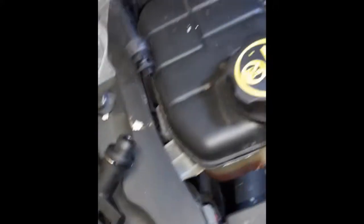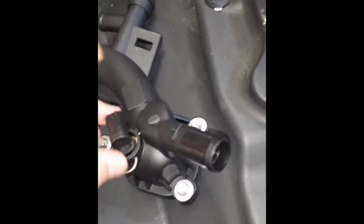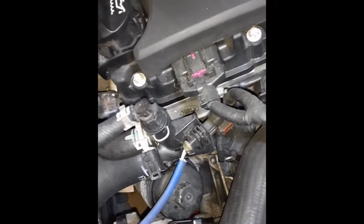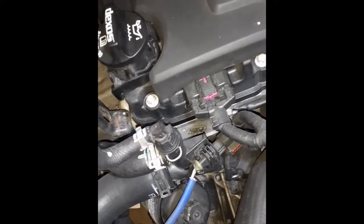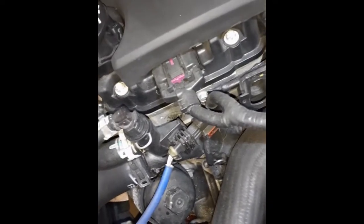It's a stupid design — it has a clip that just pulls out. There are actually four water ports: one, two, three, and four. This fitting here is for the temperature sensor, which senses your coolant temperature as it comes out, running boiling hot. From the factory, these parts seem to be thinly and cheaply made. They get brittle under the hood heat, especially in hotter climates like here in Florida or arid climates. These parts get roasted and they degrade.